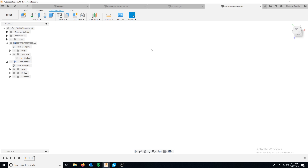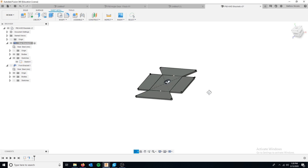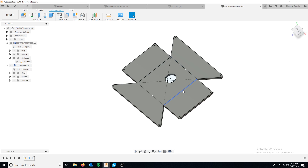The first thing to do when working on our P80 all-wheel drive brackets was to create a 3D printed prototype which we could eventually get laser cut or water jet cut out of stainless steel or some thin sheet metal and bend ourselves. I hopped into Fusion 360 and basically created a sketch after taking measurements of everything, sketching everything flat where we'll later create sheet metal flanges and then make the bends. Once we get our sketch we can unsuppress these features — this is just a flat representation of all the different profiles. We're doing 1/10th inch which is about 12 gauge stainless steel and you can pick which side you want the thickness to be on.